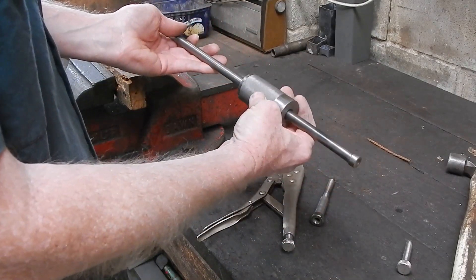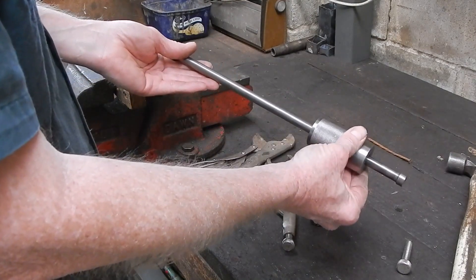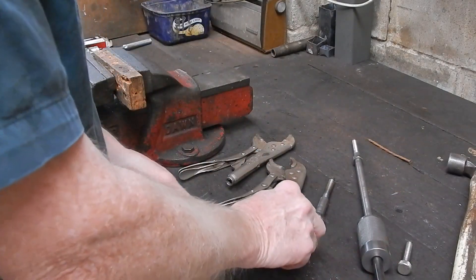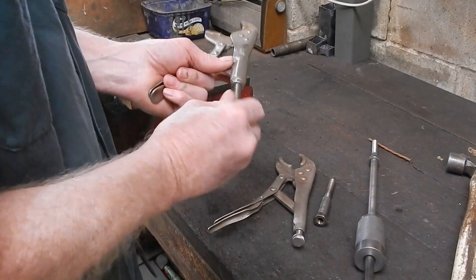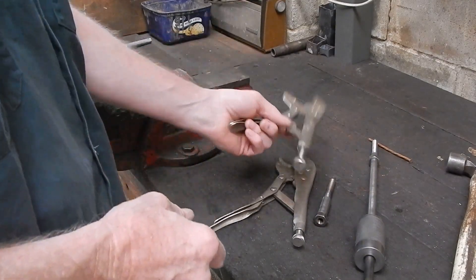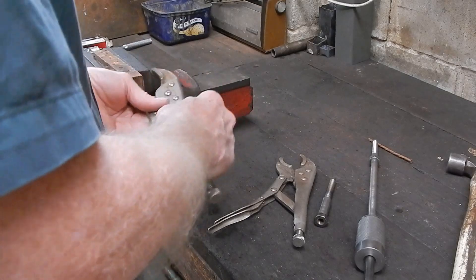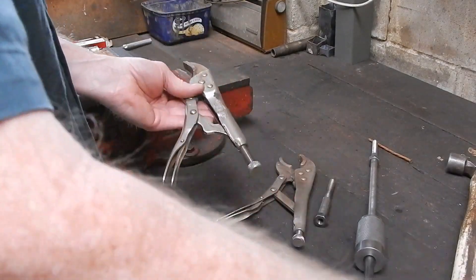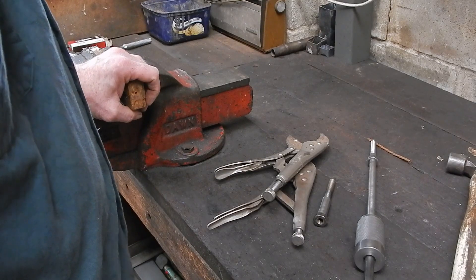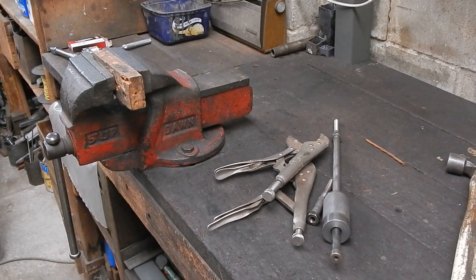I knurled this but you don't have to — that's just a bit of fancy decoration. As you can see, it's an easy turning job with basic materials and very useful. So there you go — turn your old vice grip pliers into super vice grip pliers. You'll be able to pull out stuff a lot more easily, you won't be knocking around your pliers, and you won't be restricted with getting a hammer in and all that. You just use the slide hammer action and it will pull out whatever you're going to use it on. A great little project for anybody with a metal lathe — get into it, see you next time.